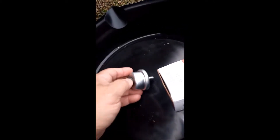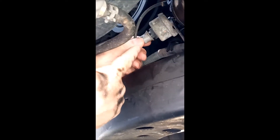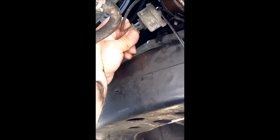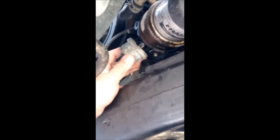I'll show you where it goes underneath the truck. There's the oil filter, and just to the left a little bit further is this piece — we're just gonna put the new one right in the same spot. It may leak some oil when you change it, so I'm gonna have the new one ready to go after I loosen up the old one. First thing is to take off this electronic line — it has a pinch part on the back side. Put that out of the way, then unscrew the old sensor using the open face wrench. I have an oil pan underneath to catch any drips.